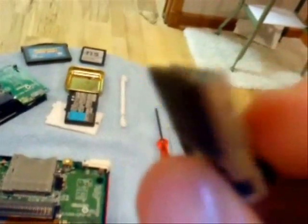Now just turn the DS Lite around. Put your thumb on the bottom side of the BIOS chip and your index finger on top, and just gently pry back and forth. This part is glued down to your DS Lite motherboard with some adhesive. With a little care and TLC you'll be able to get it off without damaging anything. Just got it unplugged from the connectors — and I present to you your Nintendo DS Lite BIOS chip. This is the corrupted one.